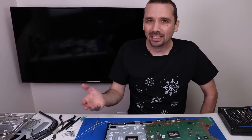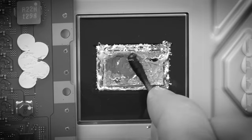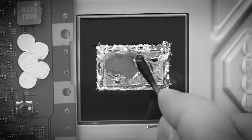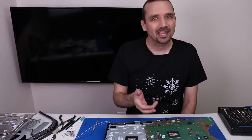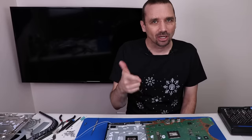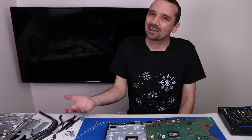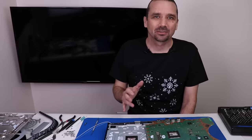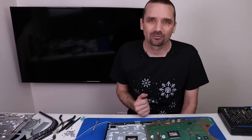I'm not saying it can't happen or that it hasn't happened — I'm just saying I find it unlikely. As far as the liquid metal having dry spots, between my experience taking these apart and what I've shown today, it's very clear that PS5s do have a problem with dry spots on the APU and oxidation on those dry spots. How widespread this problem is I have no idea, but I know that I have seen it on a number of PS5s and I've pointed it out in several of my previous PS5 repair videos.